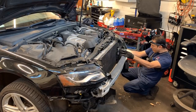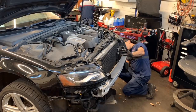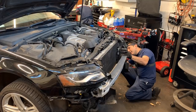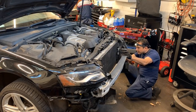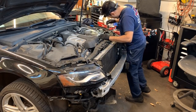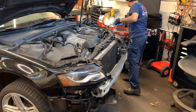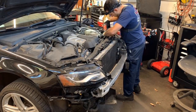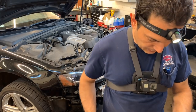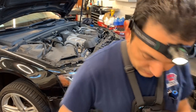Always look around and see what you need to disconnect and remove. Be careful because these cars have so much plastic — it's going to be very hard to see even with the camera. I need to get the headlights out. There's a T30 on the back of each light. The bolts for the headlights are the long ones, so you won't miss them or mix them up.